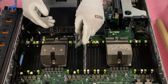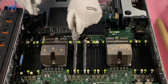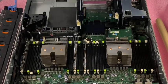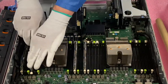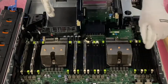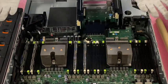We have people — it seems like every week there's someone who has an issue where they think they have a bad DIMM and it's just not fully inserted. It's just a very common user error. So if you're at home and you have a DIMM that you think is bad, rotate the DIMMs around. If the DIMM is bad, it'll follow the channels to whatever socket you move it to. Most of the time people rotate it around, they actually just insert it properly, and then there's no issue.